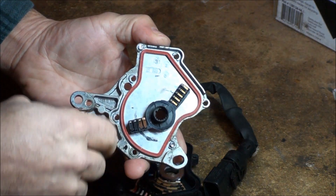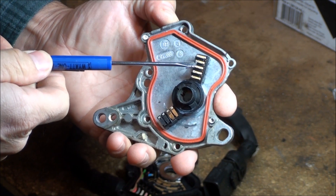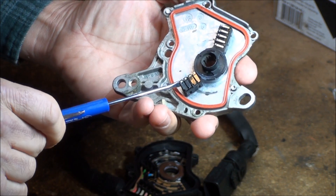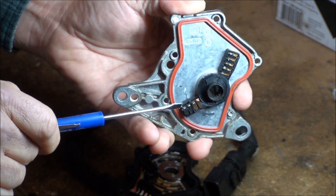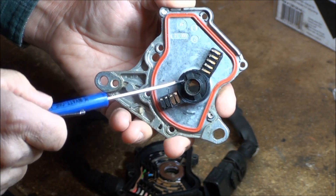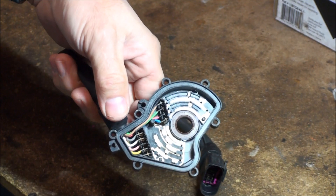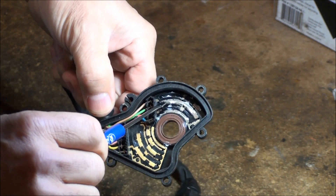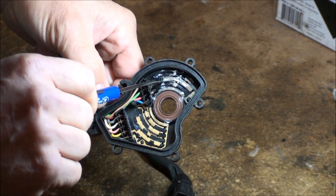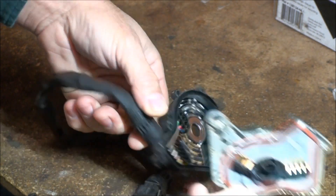I want to show you the guts. On this side we have the contacts — they have what looks like silicone grease on them. These looked a little toasty and a little worn. The grease got kind of grungy. Water didn't penetrate the gasket — it did a good job; water wasn't getting in here, so I don't believe there was any moisture because I don't see any corrosion. Inside, where those contacts ride, you can still see some of the grease, but I don't think we were getting good contact — and that's basically what the problem was. The TCM didn't know where it was.